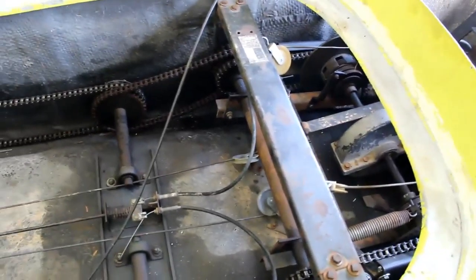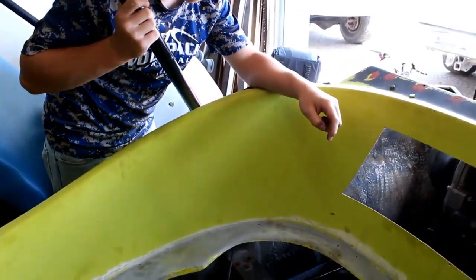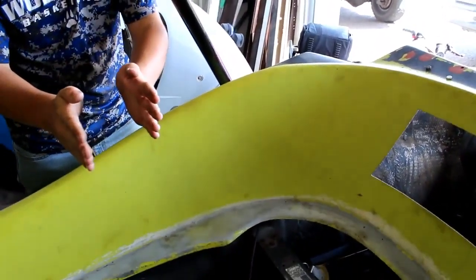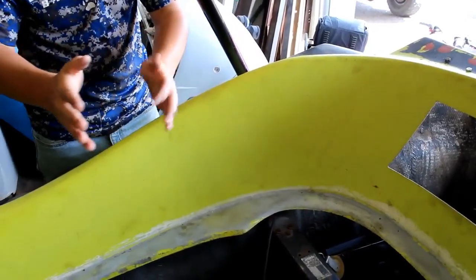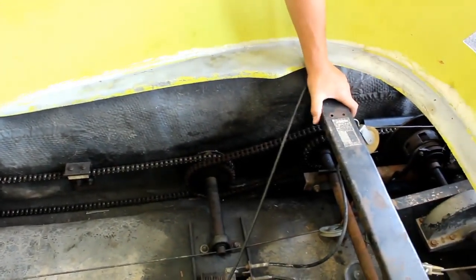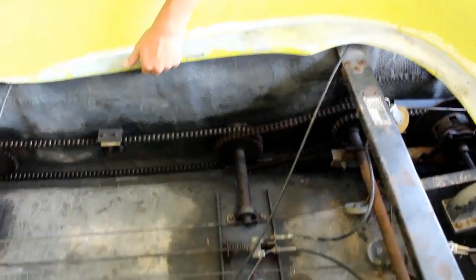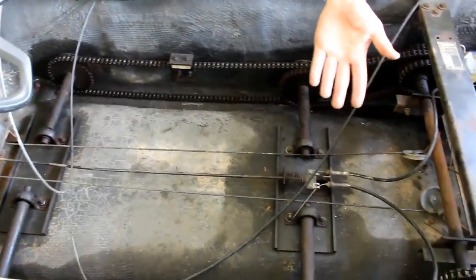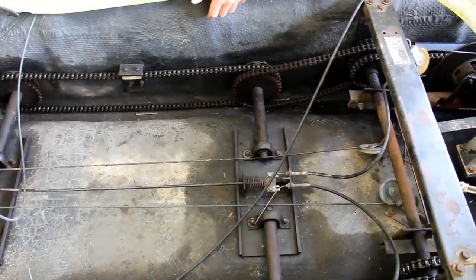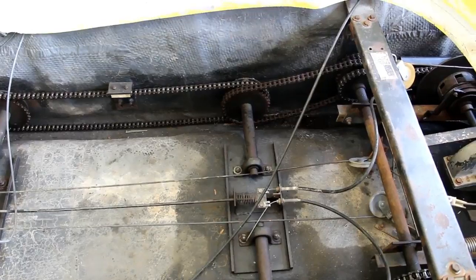Can you tell me a little bit about skid steering? Does this actually have knuckles? How does it steer? It's where one side moves faster than the other side. When you turn to the left, it would control the right side, which would let go of this side, so that side would be moving a bit faster than this side. That side would be going, say, 10 miles an hour, and this side would only be going about 8 or 9, or maybe even 7 or 5.